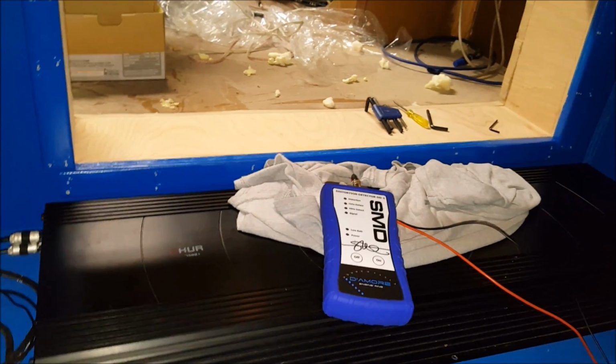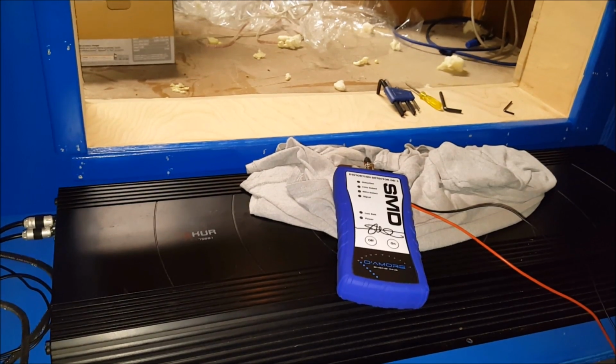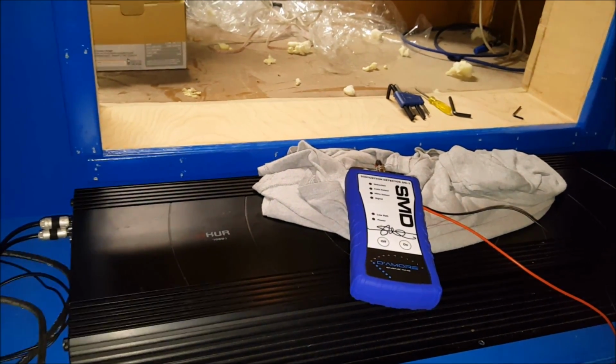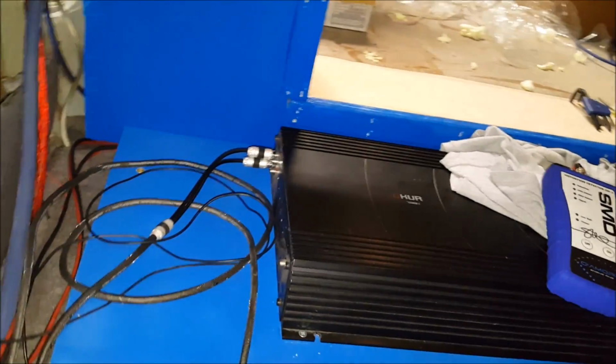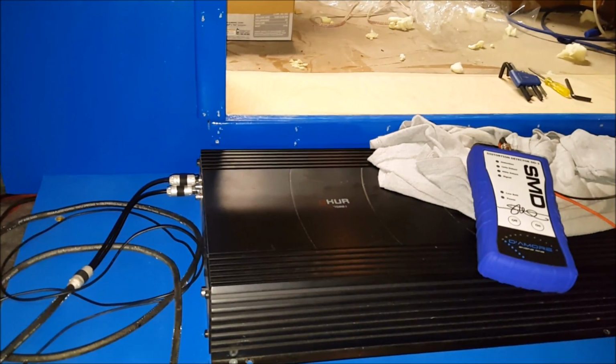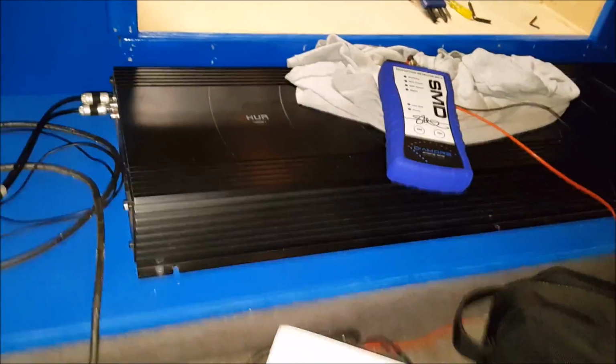So I forgot, I think I do these amps on the positives. So yeah, my head unit doesn't clip. It's a Pioneer. A lot of them, I found out, don't. And I don't know what my gain's at on here. Probably 3/4. It seems like all my DB drives clip around 3/4. So yeah, now that's set. Now I can hook my speaker wires up and continue on down the road.